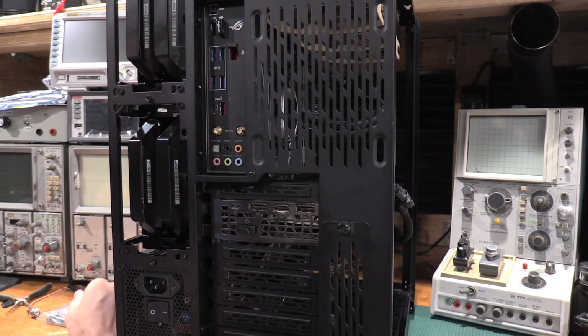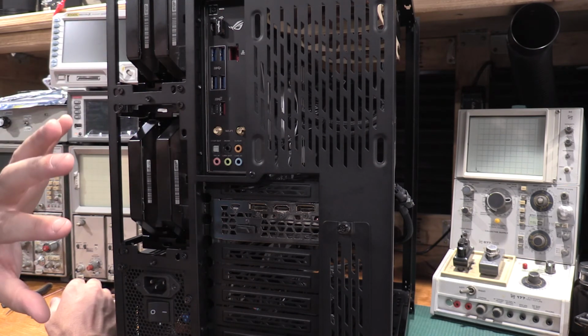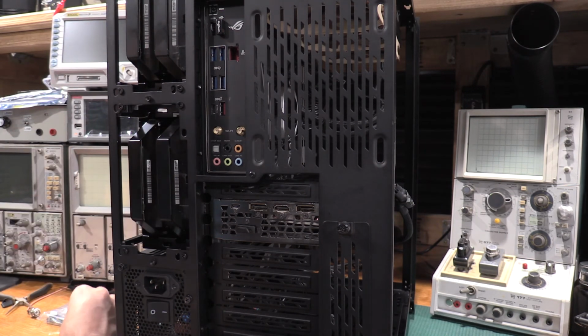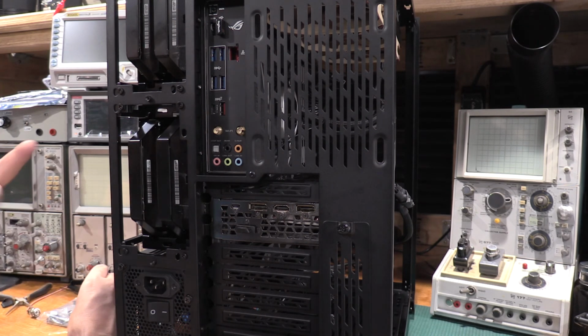So that's one of the main, there's some minor differences between desktop drives and enterprise drives. One of the key differences is there's some software in how the drive handles internal faults to itself. And the enterprise drives are most definitely geared for RAID more than the home drives. Now, the NAS drives, they're good for RAID, but they're not good for RAID sets of more than 8 drives, is what they're rated for. In the Western Digital world, those would be the red drives, but I think they max out at 8, where you shouldn't put any more than that in there.